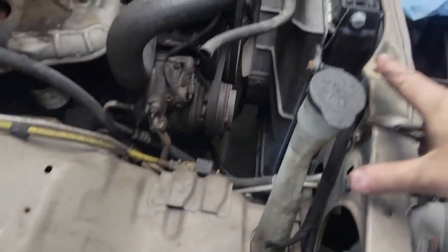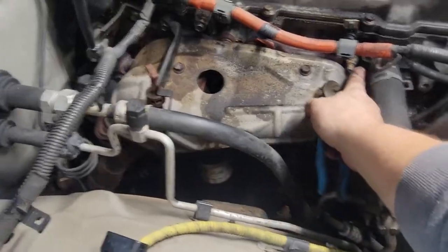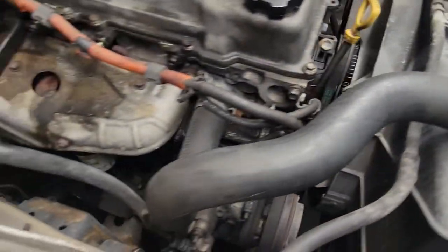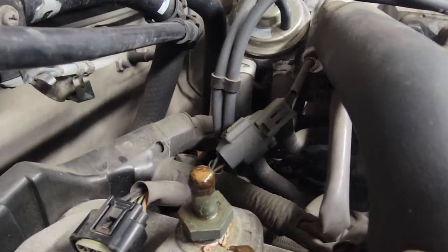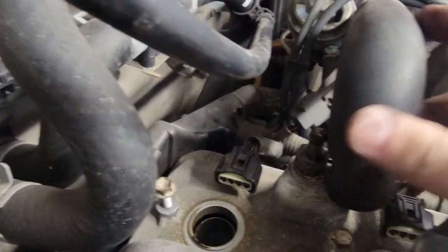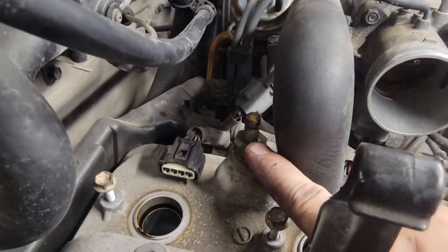I removed the bottom half of the air intake — three 12 millimeters, one, two, three. I'm going to get an extension in here and take off this 12 mil and pull the whole cap off and just disconnect it up here, keeping that as one whole unit. When I pulled my hose off, you can see what I found. I'm probably going to pull it off the intake and completely clean it out. The EGR should be cleaned out as well when I get the valve cover off.